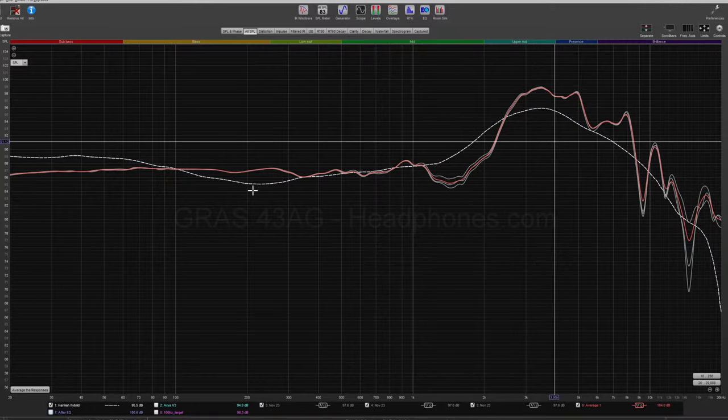So you can think of this as being somewhat neutral-bright. The target here is the Harman combined target. For those unaware, we do not want headphones to measure flat on a raw graph because our ears impact incoming sound — this is a measurement taken simulated at the eardrum, which is why you see the rise going up. Looking at the bass, in the bottom part of the ear gain there is some warmth. The ear gain refers to the amplification that results from your ears impacting the sound.